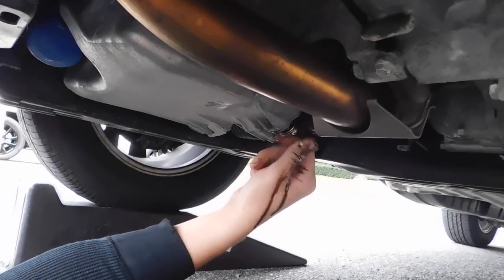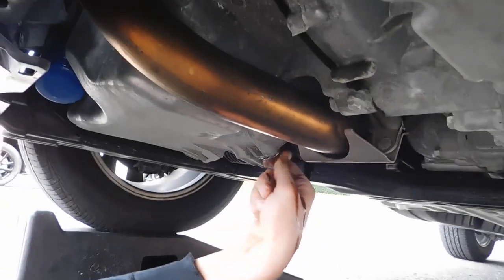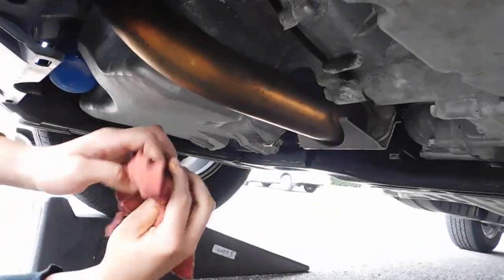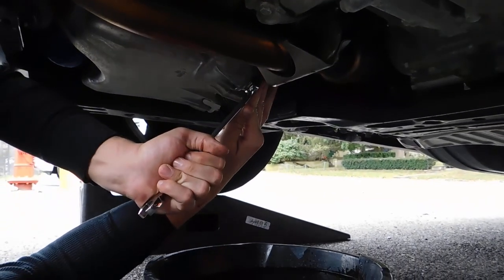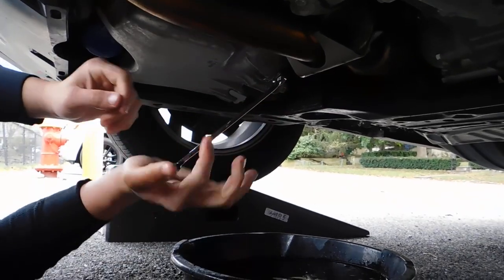It does get dirty — this is why I always bring rags. Tighten it by hand first — that will be the 17. Do a nice push or you can pull it, but I usually push so you don't over-tighten. Nice and snug, no cracks, no nothing. This car is pretty much brand new — it's only got 13,000 miles on it.